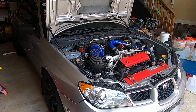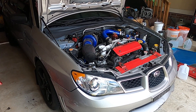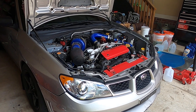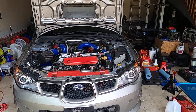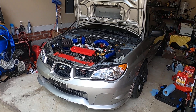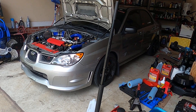That allowed me to take the car for a test drive, and I am remarkably shocked. I thought it was snake oil reading the bottle, but holy cow — the claims about Water Wetter are true. I haven't taken it on the track, just strolling around town, but temps reached 198°F, which is usually when my fans come on, and they just stayed there and started to dip. When I left the house it was about 75°F ambient and on the way home it was 85°F, but the water temp stayed the same. At cruising speeds of 55–60 mph I was seeing temps drop down to 181°F, rise back to 185°F, and drop again — the fans aren't even kicking on.